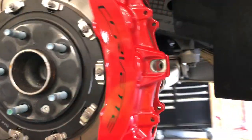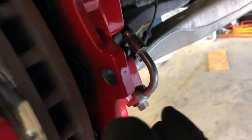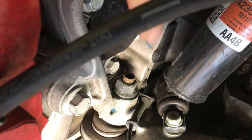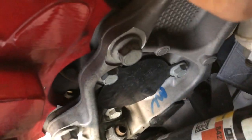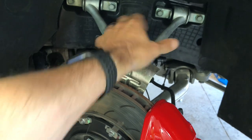I'm doing another video to show people how to change the brakes, so I've removed my track pads because I'm putting in regular pads. First thing you're going to do is back here, turn the wheel, and remove those two bolts. Those two bolts hold the caliper on there. So the caliper will come off. When the caliper comes off, take it and set it up on top on the wishbone.